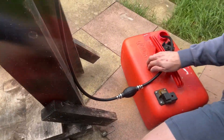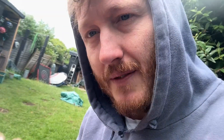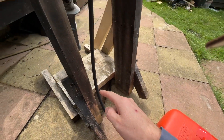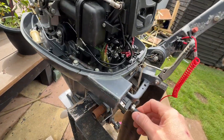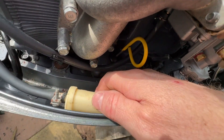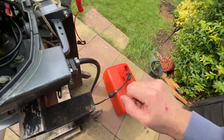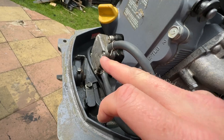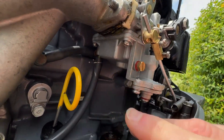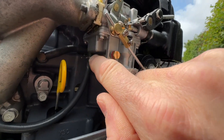Just got the Quicksilver tank. I didn't have a connector, so I've literally just had to cut the end off the fuel line and chuck it in the tank. Squeeze the primer bulb until it's solid and follow the flow. So the fuel line goes to that connector, which is pushed in, then comes all the way around to the fuel filter - make sure it's filled up when you're priming it - then up to the fuel pump, in there and out there, round here and then up into the carburettor.